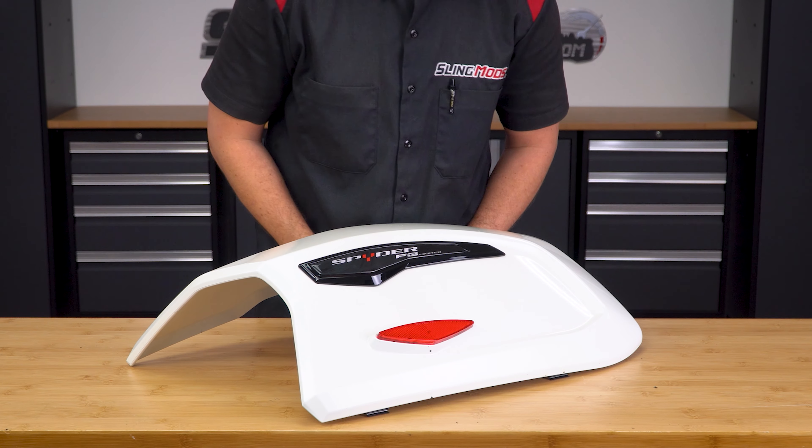Now pass the LED wire through the opening on the hinge and attach the door. Add some dielectric grease and plug in those white connectors. Wrap them with electrical tape. Tuck in any excess wire and zip tie it to the OE style harness so that it's up and out of the way of any and all moving parts. Then reinstall that push pin and those three T30 Torx screws. Reattach the cable holding the door and test it to make sure it works.